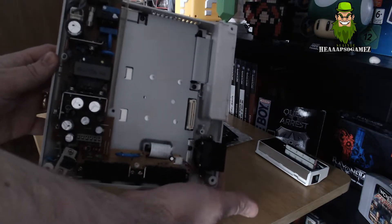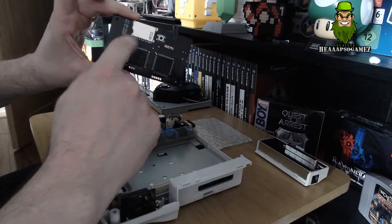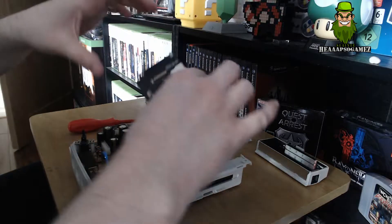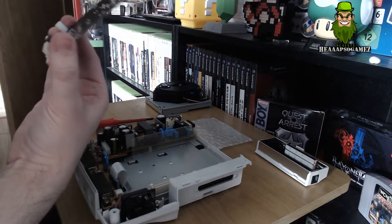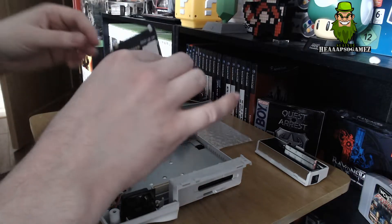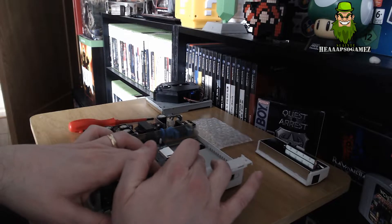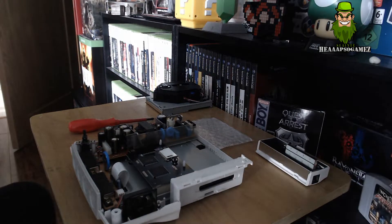Now you should be looking at the exposed main board. Push the little pegs in - this is the top end where the SD card comes out. Turn the board on its side and push these pegs right in; be careful not to strain the board, just be a little firm. As a temporary solution on the other side, you can use a bit of bluetack to prop it up, making sure not to touch the main board. Then gently slot the GDEMU board in here, being careful not to force it - it needs to be flush into the connection and as level as possible.